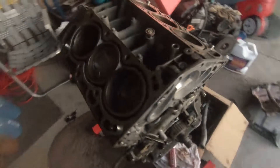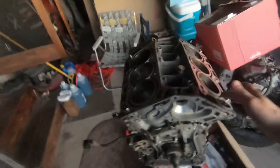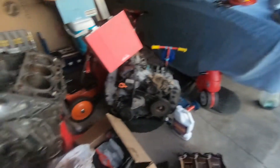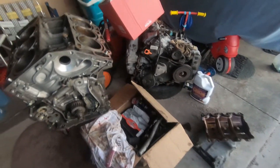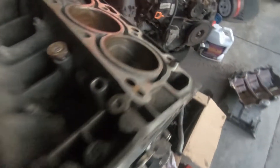About four hours later, finally got all the pistons back in their homes. The crank is pretty tight to turn over — I think that's because it needs oil; the cylinders are pretty dry. I'll come back tomorrow and flip it over, get the oil pan on, put some oil in it, and try to work it around by hand. All the pistons are in — slowly coming along. The only thing I need to order now is my valve train, then I can put the heads together, put the heads on it, and it's ready to rip.